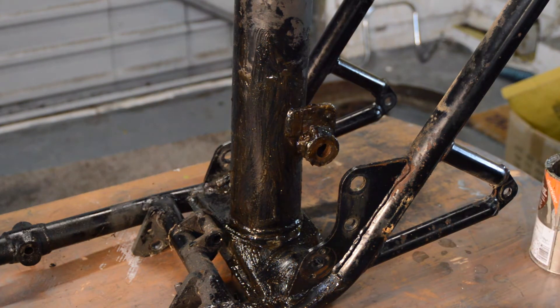The frame is now in etch, which means I can handle it a lot more easily. The darker gray sections visible are where there were still minor bits of paint stuck in gaps from the stripping process that I hadn't spotted before I etched it — those were scraped out. An aerosol was used which is U-pol — I think it's Acid 8 — and there's also a darker U-pol on there. Both are extremely good; in fact, the frame could easily have been done in aerosol alone.